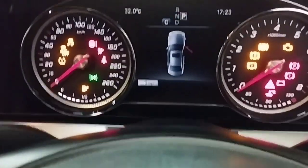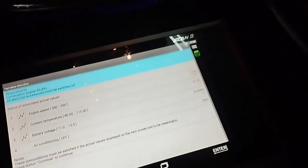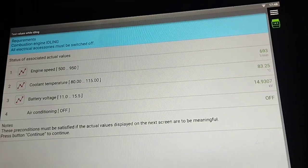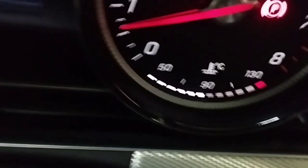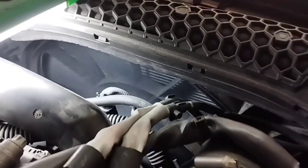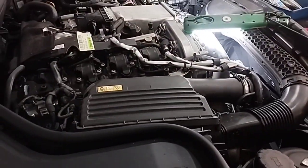Now start the engine of the car. After running the engine for some time, check the coolant temperature with the scan computer — the coolant temperature is normal, reading between 80 and 86 degrees Celsius, and the coolant fan is now running. The engine temperature is normal with no problems. If you have any questions or need clarification about something in the video, please leave a comment below.